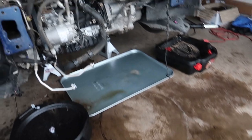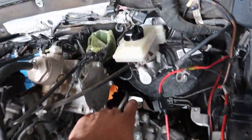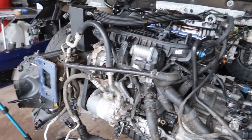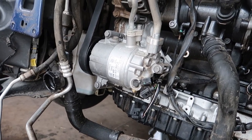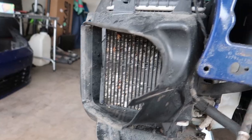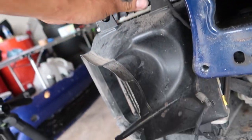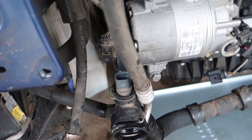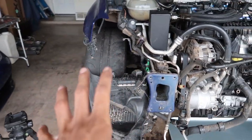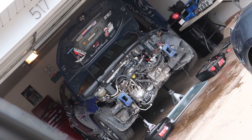I decided to make a big mess - I forgot I had this drain pan in the truck that I bought today. Battery out, intake out, charge pipes and discharge pipes for the intercooler are out of the way. Sprayed everything down with some brake cleaner. The AC is going. For this aux radiator there's an ugly hose that goes across the top - it comes right off the thermostat/water pump housing, goes down to the aux rad, and tees back in. That would be really easy to delete - whether I cap it or just run a hose from here to here. I'm pretty sure I'm just going to delete that whole thing so I can run the brake ducting I want and just upgrade radiators.